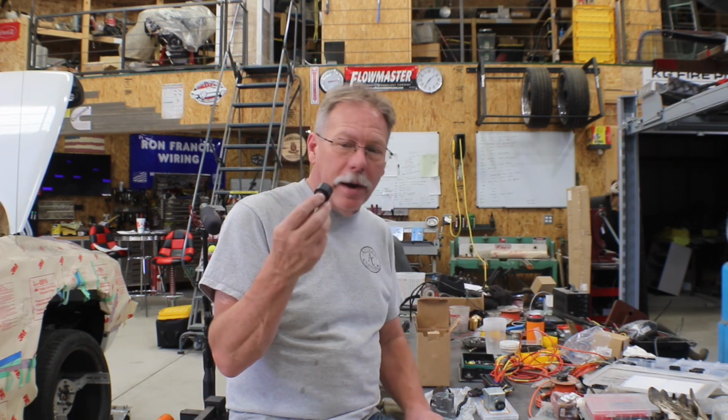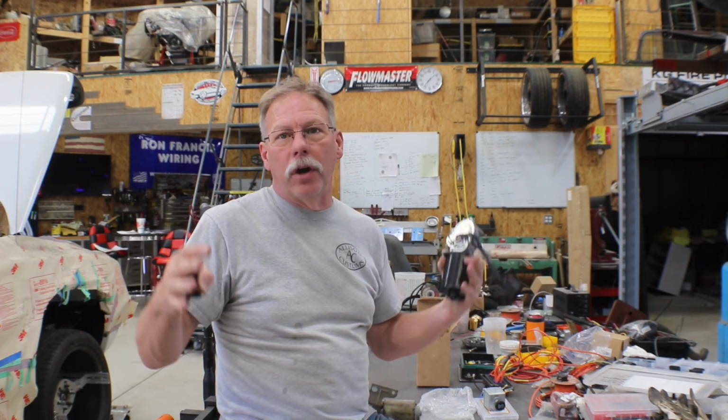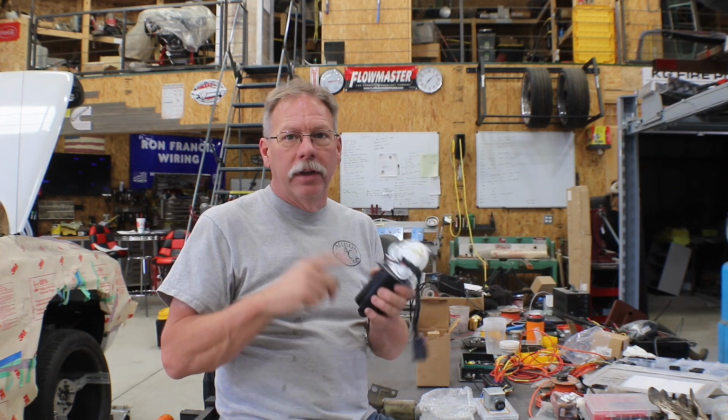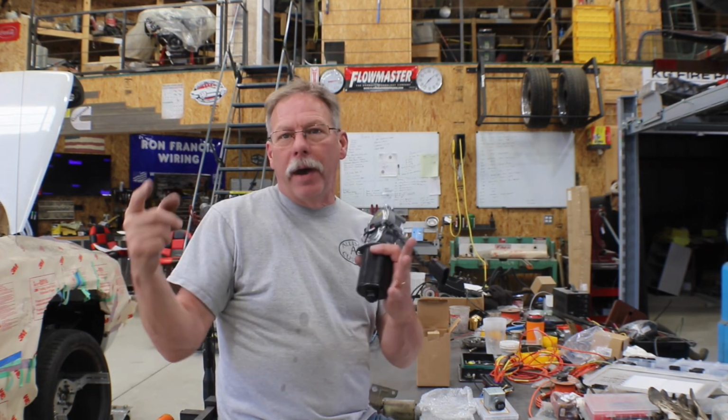So be careful about cutting it. A great solution: what I did on the other two cars that I mentioned is I went to the junkyard and got a used drop-in wiper arm assembly. It's all one component. It has the arms, the pivots, the motor, the little pigtail, and then I had them cut about a foot of the factory body side part of the connector, so I would be able to use a factory connector here.